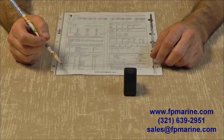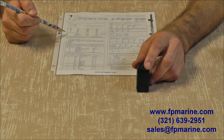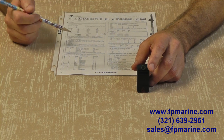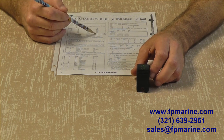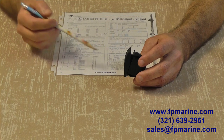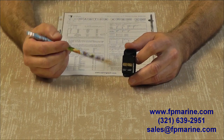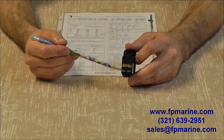The next switch is a specialty circuit switch, typically used for ignition, indicated by an M. It'll be a little easier if I explain this switch backwards, starting with position number three of the actuator, which is in the down position. Reading down column three, the M circuit is going to be off. In position number two, it connects terminals two and three. This would typically be wired to the ignition portion of the circuit — it's constant on.